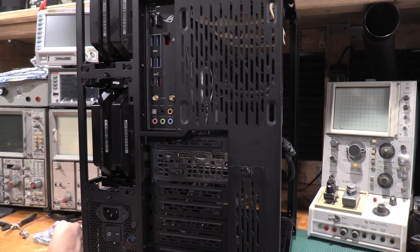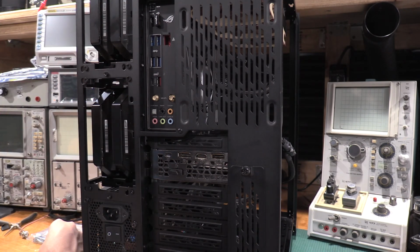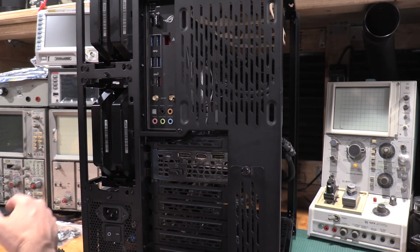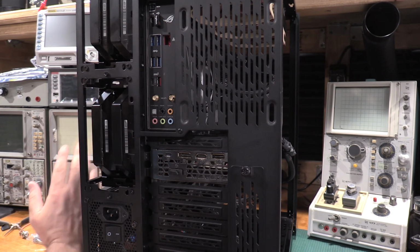On that one, because there's so many drives, I am using enterprise drives. I'm not using regular drives. If you're going to set up a RAID array, don't use the mainstream drives. I've had very good luck with the black editions on Western Digital, but I wouldn't advise RAID on non-enterprise drives. I'm getting away with it. It seems to be stable. I haven't had too much of a problem with it. But I have had on blue drives and the non-performance drives, some drives will just fall out of the array for no reason. It'll rebuild fine, but it'll just go, yep, for right now, and fall out of the array.